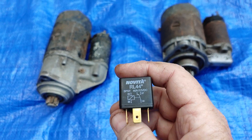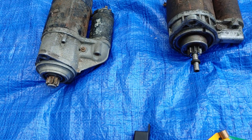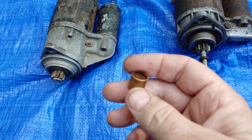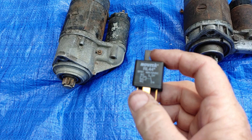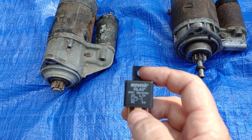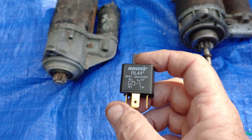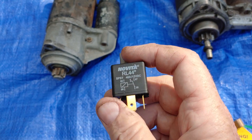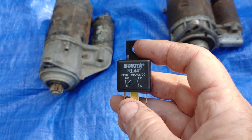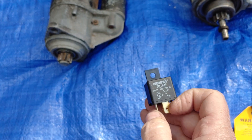So I went to go install this relay, and it says that if this doesn't correct the problem, or if the car makes a clunking noise, it could be a worn-out bushing. Here's my concern: I have not installed the relay yet, because when I turn the ignition I hear the clicking noise on the idle plunger and I hear a clunk, as if the motor was locked up. But I can spin the motor — it spins freely. So that would tell me that it's not a voltage problem in this situation.